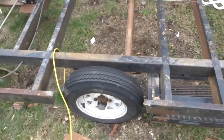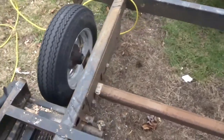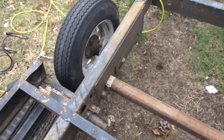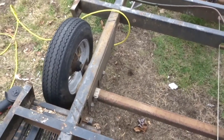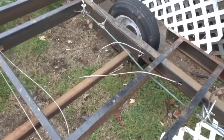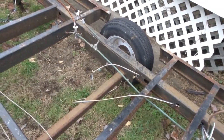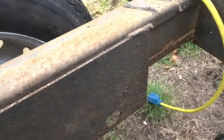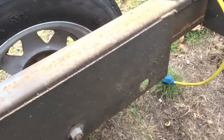Right now the trailer project has this torsion axle, and while it's great for ride and comfort, it doesn't leave me a lot of adjustability. It's got small spindles and I can't go in or out with it, I can't change the size. The new axle I got is actually going to be too wide for this trailer, so I'm going to cut that down and weld it with some DOM tubing to get it a bit smaller. Step one is to cut the welds here and underneath and get this out of the way, and then I can start working from there.